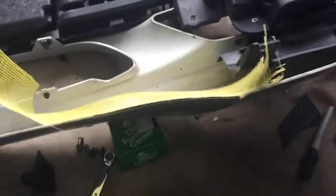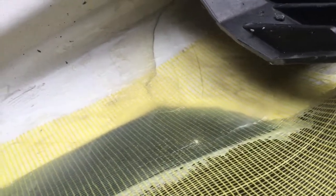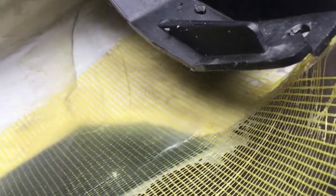My next step is to mix up some of this epoxy — probably the whole tube — and I'll plaster it all over there and just smear it in there. I used up the whole rest of that double tube and it looks like just enough to get a pretty decent layer on there in that mesh. I went beyond — it goes way over into here, an inch past, at least inch and a half, and I did the same on this side. This mesh will be stuck pretty good to that original bumper plastic. I'll probably mix up another tube and put another heavier coat on, but I'm going to let this set up first.